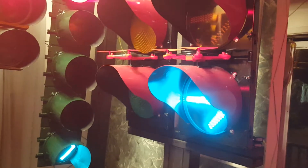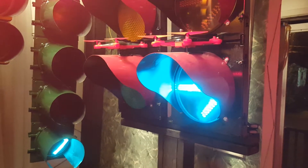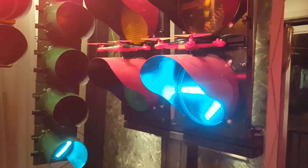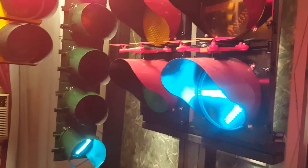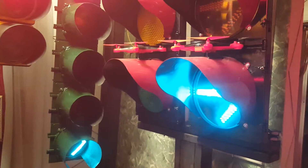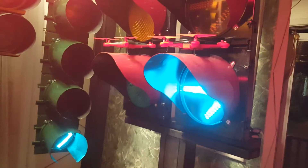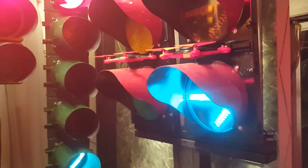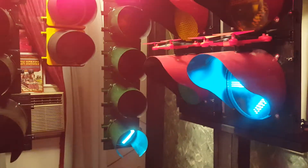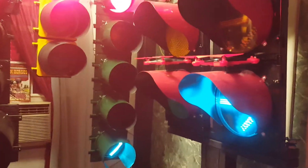So like I said, there's a decision point after each cycle. Once one turns red, if the switch is thrown — flash mode. If the switch isn't thrown, stays in regular mode. It was a pain because I had to do what Matt McCain taught me before with my sensor flashing yellow sensor light. I had to wire the switch with a resistor, because when I just did the switch alone, it would randomly go into flash mode and then just randomly go back into full phase mode. So I had to do the whole resistor thing.